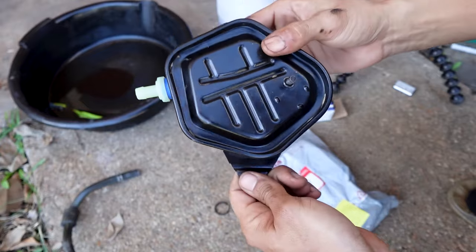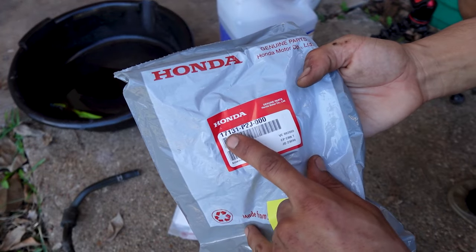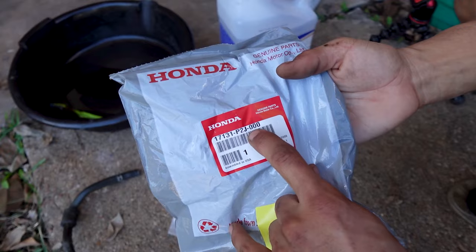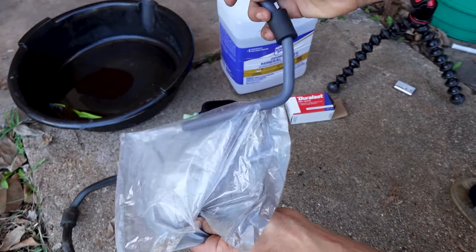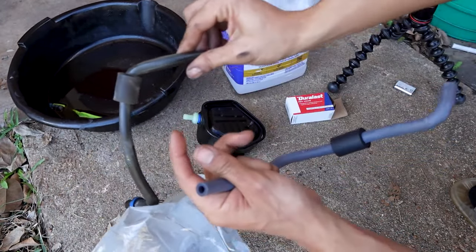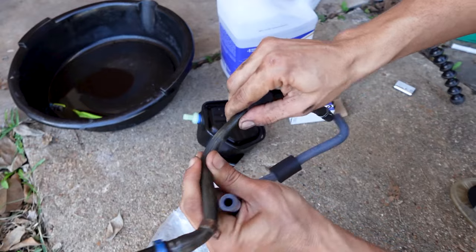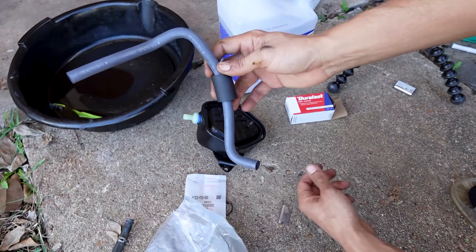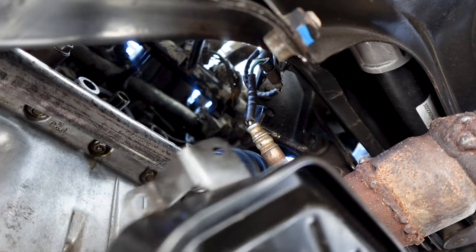Here's how I'm going to install the PCV breather box — without the hose attached, just to make it a little bit easier. I did purchase a new hose — part number 17131-P2J-000. This brand new PCV hose feels a whole lot better, real pliable and bendable, compared to the old one. The old one is trash and this new one will go in after I put the box in. Everything is cleaned up as much as I could, wasn't too dirty, so I'm going to try to stick this up in there — hopefully it's not too hard.